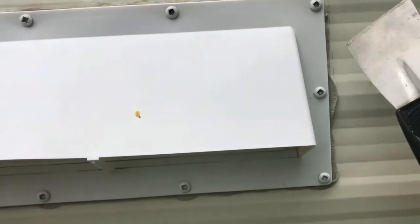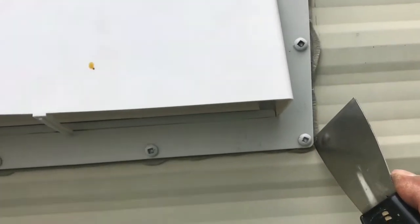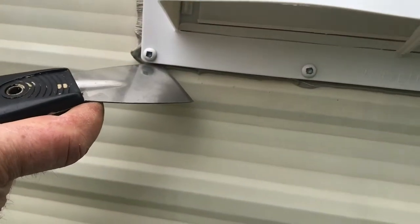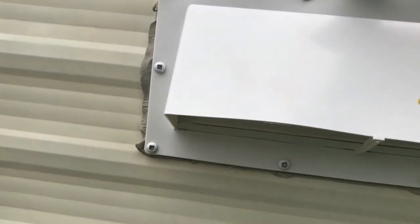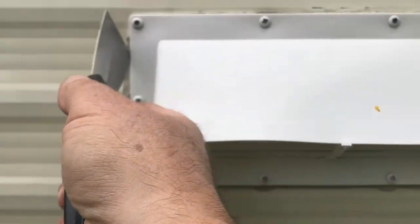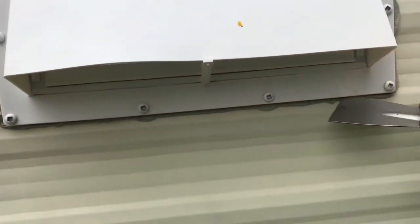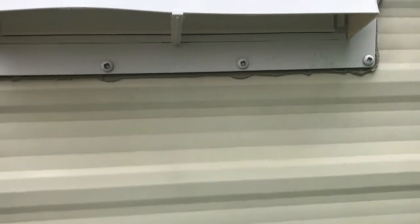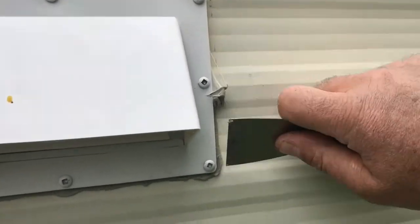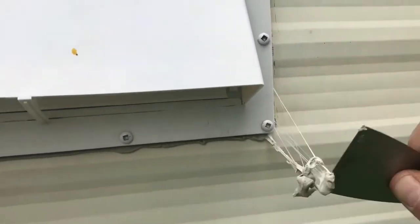Here's the new vent — just have to scrape away the excess putty and take a sharp tool or knife to follow along. You should follow up with silicone if you want that little extra insurance. Easy peasy.